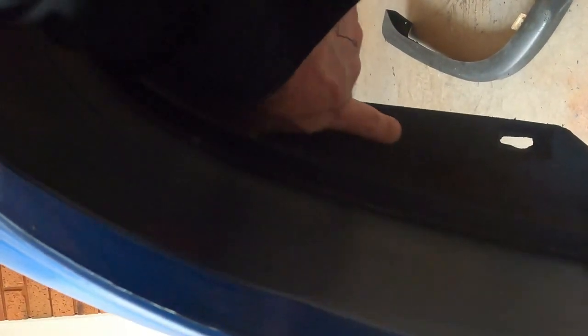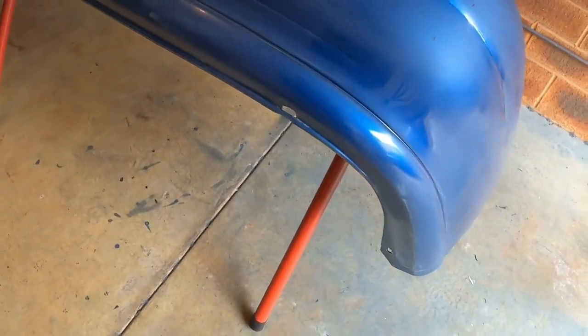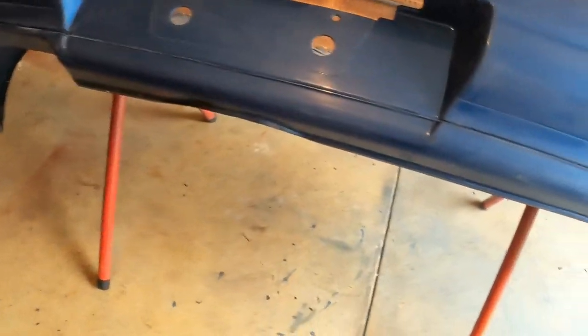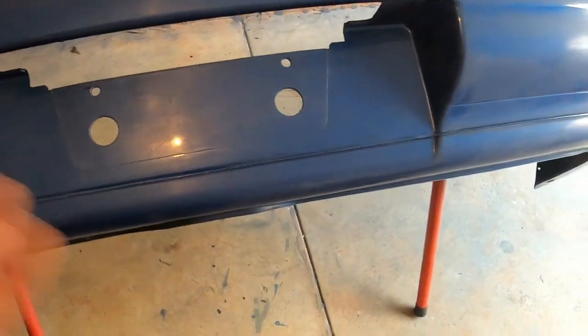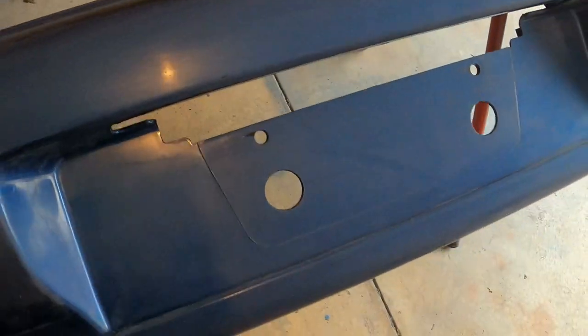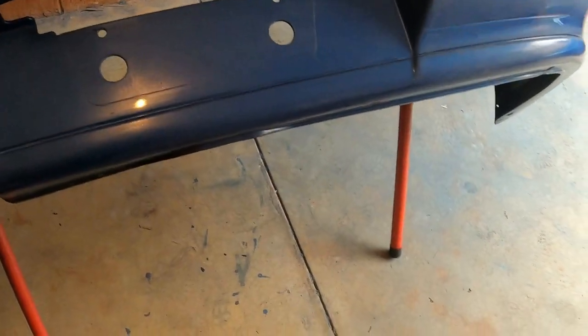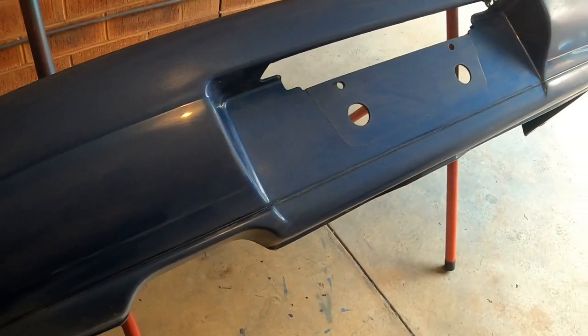This should be an easy fix at the bottom. You just need to line them up and drill a couple of holes for it to fit. Once it's done, I'll do the other side as well. After that, a quick sand on all the areas — no point in painting one separately from the other. I'll install both of them together. After I prep them correctly, then I'll paint them. Because this one is pure black plastic with no paint on top, I need to use the plastic primer. Since some areas are showing bare plastic, I'm going to prime the whole area to be on the safe side. If we're lucky and get it all sorted in time, we might actually paint the rear bumper.